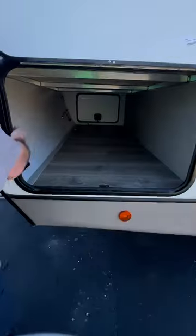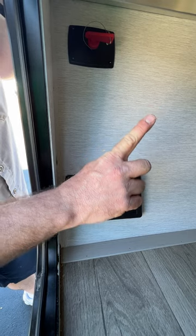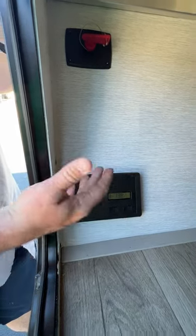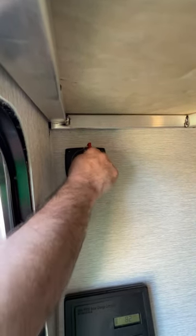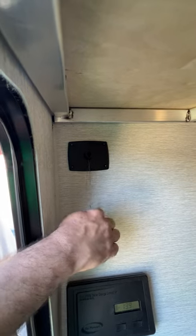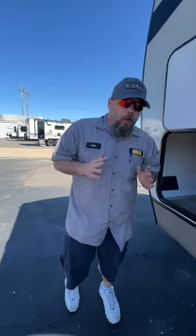Right over here on this side wall, we're going to have a couple of things. One is going to be your solar controller panel. This just helps monitor the battery. Once the battery gets below a certain level, it will allow the surge coming from the panels on the roof to come through and charge the battery for us. There isn't a whole lot you have to do with this guy, except if you get a different style battery, you go in and change the battery setting. Up above here is where our battery disconnect is located. This disconnects the camper from the battery so anything left on would not drain the battery. That key must always be in the on position whenever you're plugged into shore power or hooked to a tow vehicle.